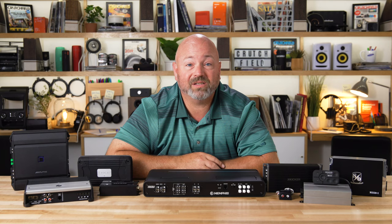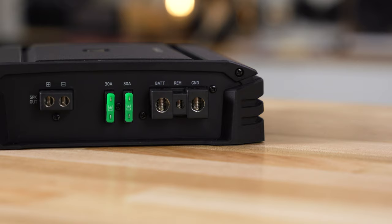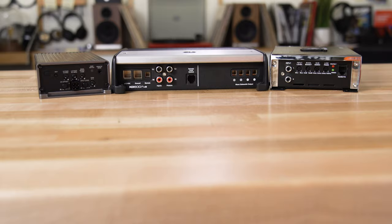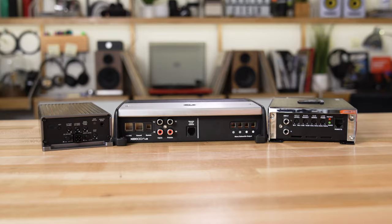One of the best ways to upgrade the sound in your car is to replace the radio, but that's getting harder. Cars are more complex with more features and integrated dashes that make that harder every day, so you can always get better sound by adding an amplifier and new speakers, maybe a subwoofer. We have many amplifiers that are designed to do just that — to be easy to integrate with your factory radio. They'll have speaker level inputs, and there are even fancy interfaces designed to make the new amplifier work with the factory radio and the computer in your vehicle.